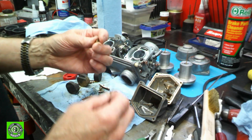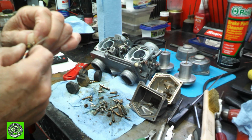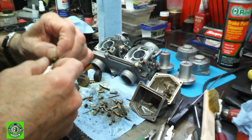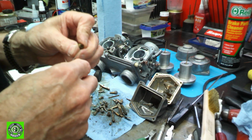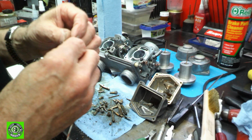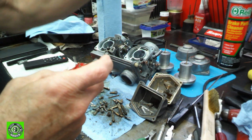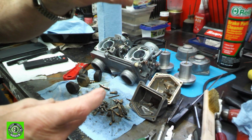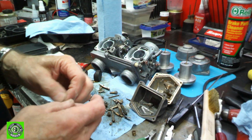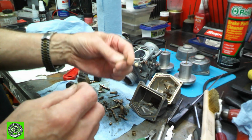The reason that we're doing this is because many people say, oh yes, go on ahead and use the welding tip files to do that or something else, and doing that ruins the jet. What we're doing here by poking it through, and see me twisting away at it, is I am cleaning up the jet without any harm to it whatsoever. If we feel that it's a little too loose, you can put a few strands through it, but for the most part, just take a strand of wire, stuff it through, check it, as we're doing here, making sure that there's some sort of light coming through it, and when you're done, put it away, grab the next jet, and you can do this to all the jets. You should do it to all the jets.